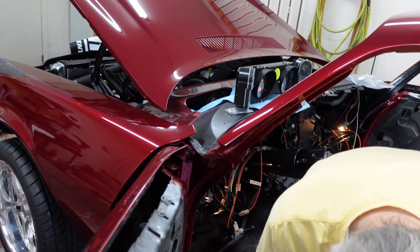Everything — all of the wiring is working, which is awesome. We weren't able to verify if the reverse lockout is engaging when the car is in motion. We put it in gear and let it go, but this thing's really not happy running in the air like this. The rear end's making some clanking noises and the right rear is not turning, so it's like the posi's trying to engage and disengage. We can't really get it going very fast — about 10 miles an hour, everything starts to get a little wonky. We got the speedometer working. So everything under the dash here is good, as far as I can tell. We're ready to button this thing up.